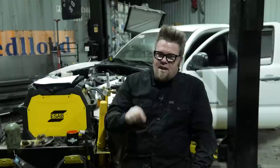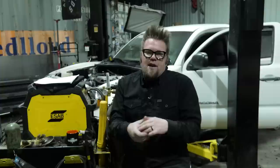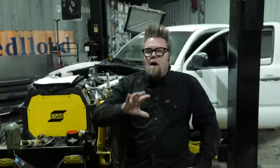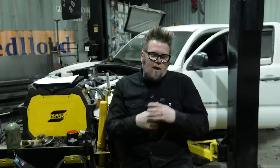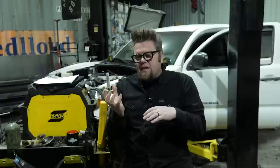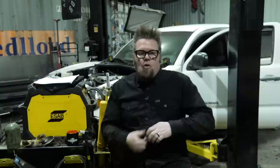By applying gear reduction at the wheel itself, you eliminate stress on the drivetrain components in the independent suspension system that routinely failed. It wasn't a failure of the product — it's that when you're rock crawling at King of the Hammers and abusing the vehicle for eight to ten hours, you're asking a lot of CV joints. Not only do they have to transmit power, they also have to turn and pivot, and they're working at max angle at very regular intervals inside the rocks.